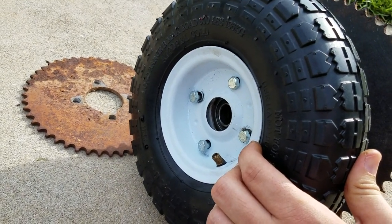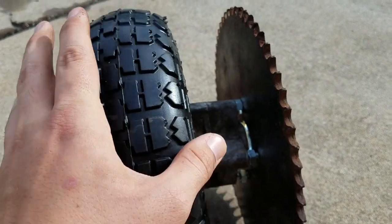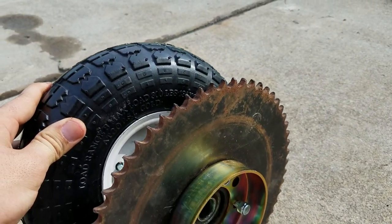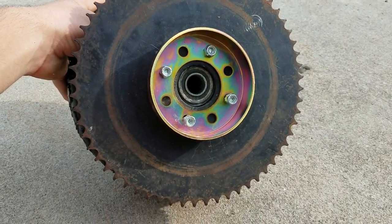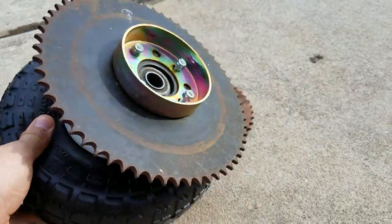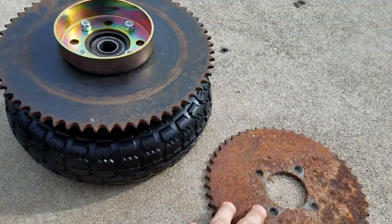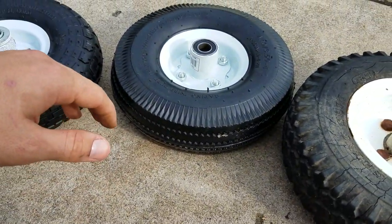When making a one-wheel drive system, you can set it up — you just need to get extended bolts and put your connector in there. But you have to consider how tall your tire is. You can see that the sprocket is actually bigger than the tire, so it will be swapped out later with a smaller sprocket. You really have to consider how tall you want your go-kart to make sure nothing's going to be grinding.